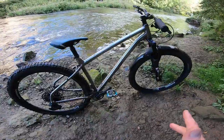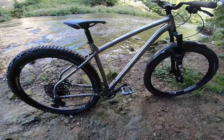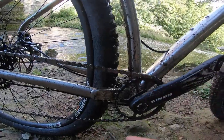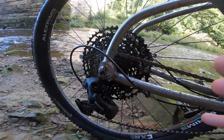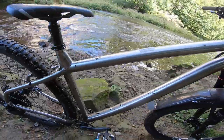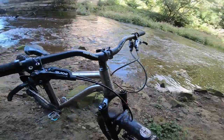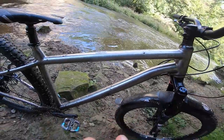I'm just going to point out some of the detailing which obviously you won't see when you're riding — there is a full tech talk video which goes into more detail in a static situation. You've got these really nice cut-away machined pieces behind the chainset to give more mud clearance and clearance for a 42-tooth chainring. Really sweetly detailed dropout ends, fully CNC machined. Curved rear stays, nice over-shot seat stays, tons of tyre room even with these 2.4s, curved multi-butted tube set, and up front a really nicely machined Titus head badge — proper premium quality.